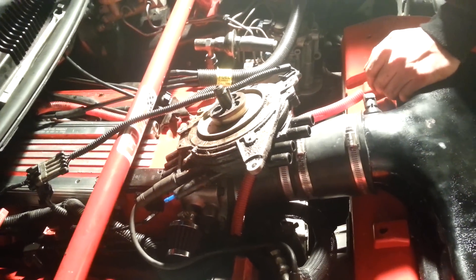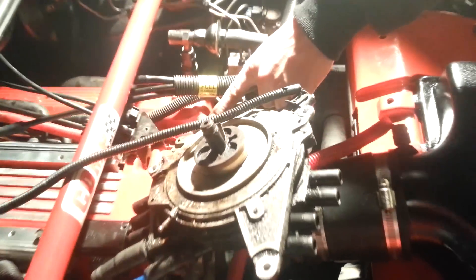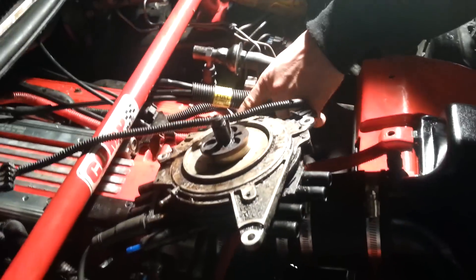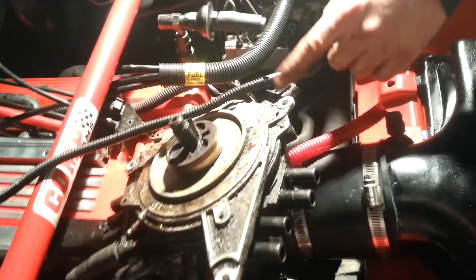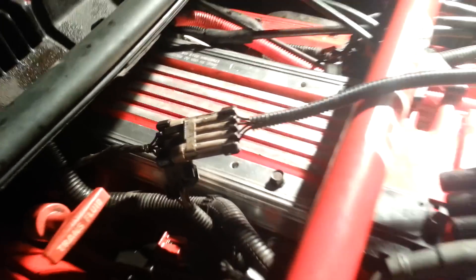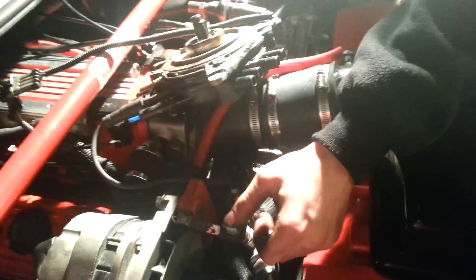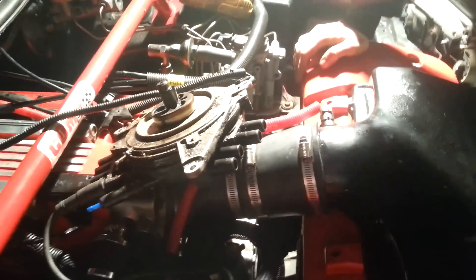What I've done is taken the wire from the coil right here that hooks down into where it would normally connect — it goes from the coil to the OptiSpark — and I've connected it here. I've taken the OptiSpark short harness and connected it to the car up there. Then I took the spark plug out of my motor and took the number one cylinder plug wire off my motor and connected it to the number one spot.